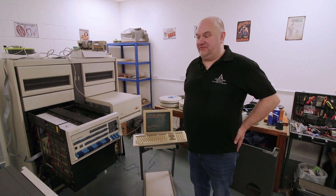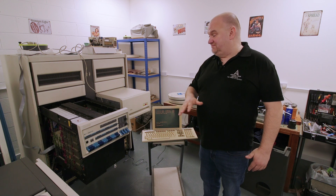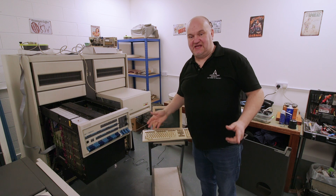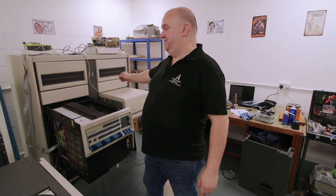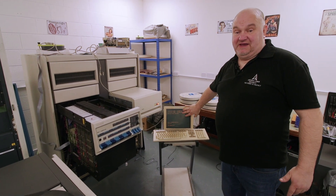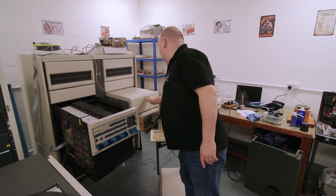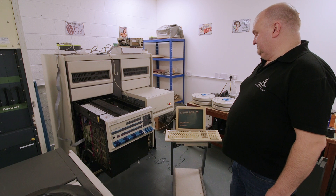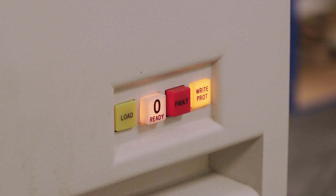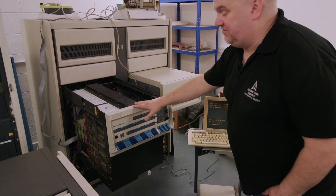I'm going to show you the PDP 11/70 booting. We initially boot from this drive and then ultimately boot from the second drive. The reason is the second drive has newer software, but we don't have the firmware in the machine at the moment to properly boot that drive, so it's a two-stage process. We'll start by powering on the PDP — we'll get nothing on the screen yet. Not until we start these drives and start the system booting off the operating system. So we'll start this drive first. That drive's now come live and we load a start address on the console to start the microcode that then boots this disk drive.